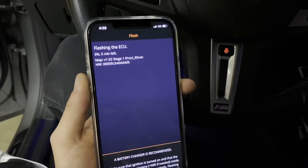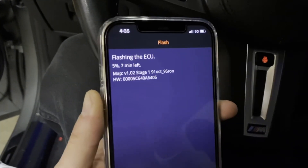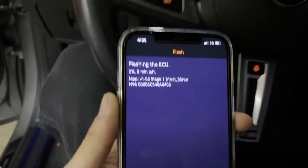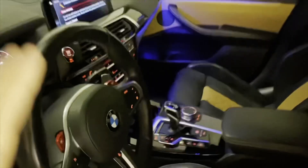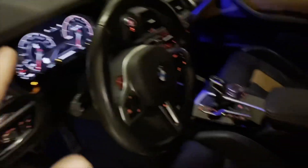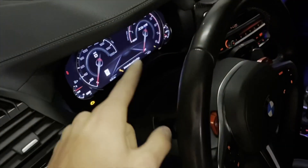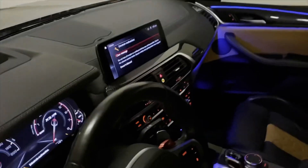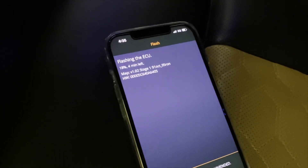Alright, prepping the flash. I'm not sure what I clicked in the last clip but we are back. It's showing five to seven minutes and it'll keep going up little by little — we're already at five percent done. As stated, you do not want to mess with anything inside the car. Don't open or close doors, don't interfere with anything that could disrupt the flash. You're going to see a lot of lights on your dash, like the drivetrain malfunction warning. We're already at 16 percent.